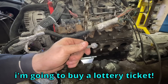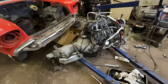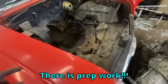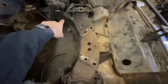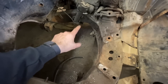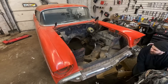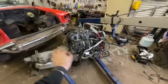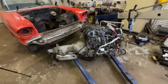Getting those exhaust studs pulled out was the last of the prep work before we can get her back in the car — it should never need to come back out after this. I do need to grind the metal and get it clean on these edges where my mounts will go. I'm going to weld them in rather than bolt them in, so we need to get all that cleaned out — a hell of a lot easier to do right now before there's a motor in it. Surfaces are prepped, went ahead and threw the mounts back on — everything is ready.